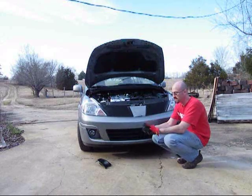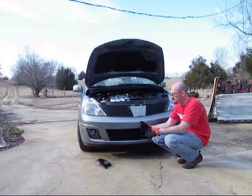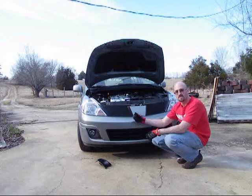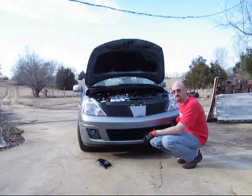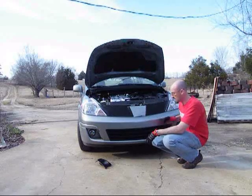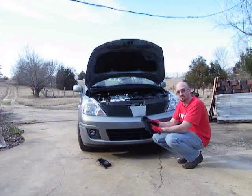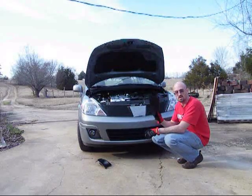Once you do that, you can feed it through the fog lamp and put the fog lamp connector on both sides. On the back side, if you buy a kit from somewhere like Versus Speed or an OEM supplier, there's a bolt for the back side. That can be reached if you jack the car up — put the bolt in there and tighten that up. That will secure the fog lamps to the fascia. I'll then need to cut these out so you can get light through, and then we'll move to the inside.